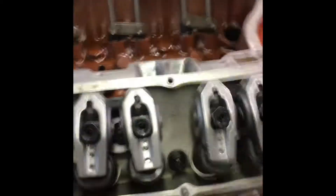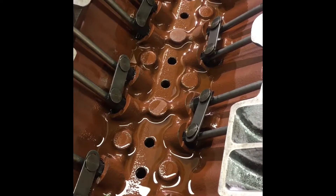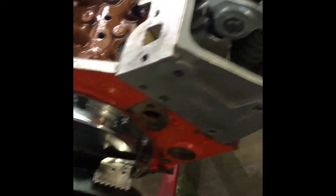I already put some oil in the motor last night when I was here trying to set my roller rockers and everything else, so I had to dump some oil in it. I kind of got everything all set. The head studs — they're always long — and right there you can see it hits the side of the roller rockers. This one here is barely clearing — you can see daylight — so I think I'm just gonna grind that roller rocker down just a little bit.